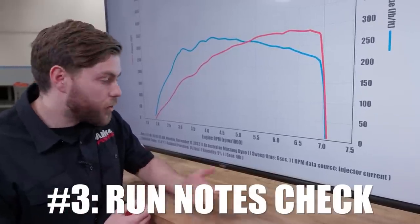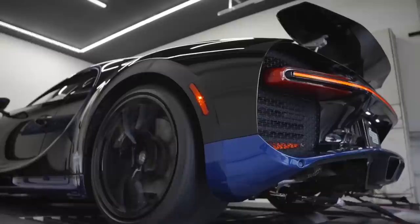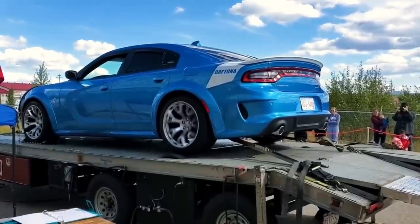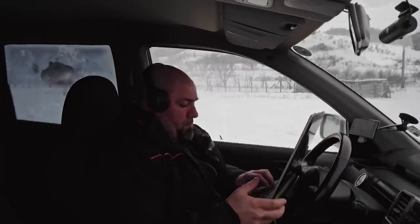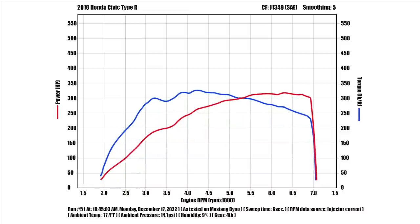The third method is pretty simple — it's just checking your surrounding data. This includes things like time of day, day of year, and your ambient conditions, because if your air density is affected, so is your horsepower. Someone trying to artificially boost their numbers might run the baseline during the hottest part of the day, and run with their parts during the coldest part of the day. Even if the dyno run isn't a comparison with the baseline, it's important to understand how optimal the conditions of the run were. A run done on the coldest morning of the year with no humidity and a long sweep will show higher results than the same vehicle on the same dyno on the hottest day with a short sweep. If correction factors aren't applied to a run done with better conditions than a standard day, the results will show an inflated gain. Similarly, applying a heavy correction factor when the conditions don't call for it can boost numbers way beyond what the vehicle is actually making. There are lots of ways these numbers can be skewed, and although a lot of these are intentional, they could just be dumb mistakes.